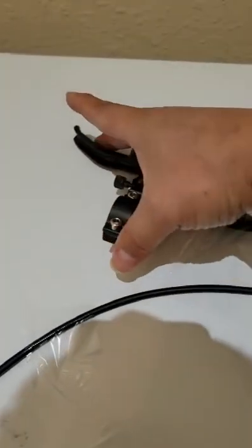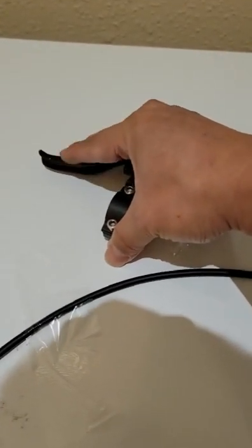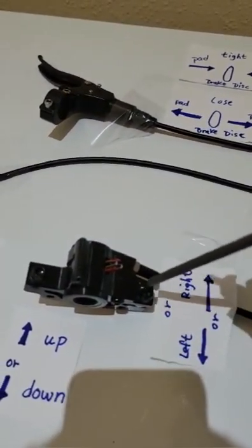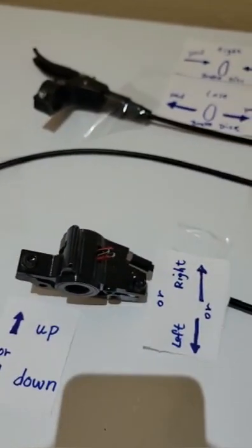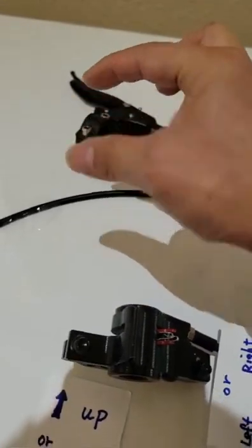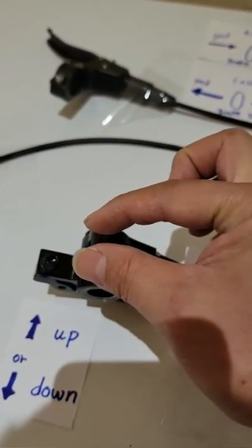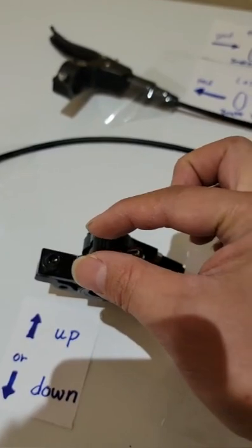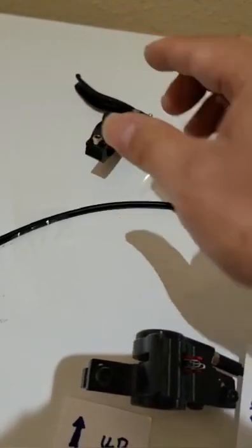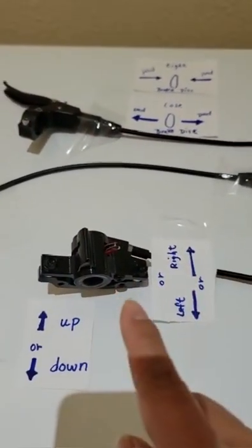Number one, hit the brakes and hold, not moving, and holding. And then number two, we can tighten the screw in here. So it will be perfect, because when you're holding the brakes, that means the brake pad is holding the brake disc, no space. So that's how we adjust the brakes. After you tighten those screws, you release it, and then you roll the motor, so you can find the perfect adjustment.